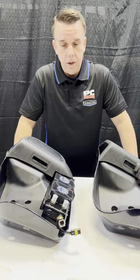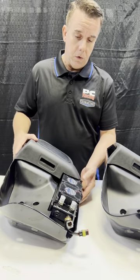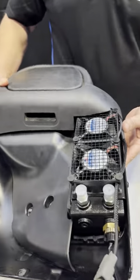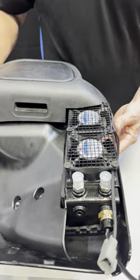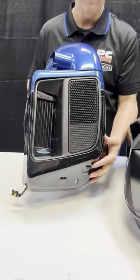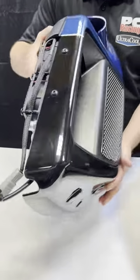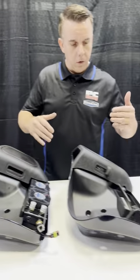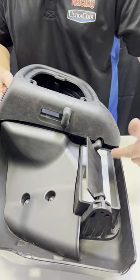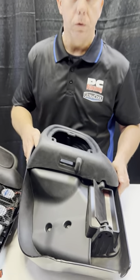Here it is. What we're doing now is actually mounting it into the lower fairing. We're cutting the air duct and the air door out, and the Ultra Cool Oil Cooler mounts inside here. A little bit of trimming on this piece, but the end result is just fantastic. It utilizes the air duct for the air door, looks like it belongs on the bike, and just has a great look to it. I'm going to show you how to go from the stock system with the air door, take that out, do the trimming necessary to get the Ultra Cool mounted inside, and get your bike ultra cool. Let's get started.